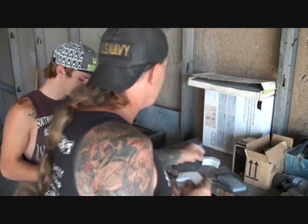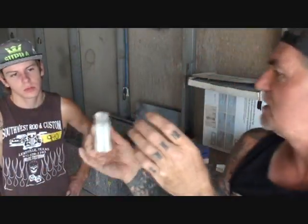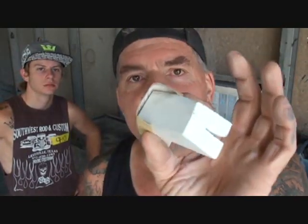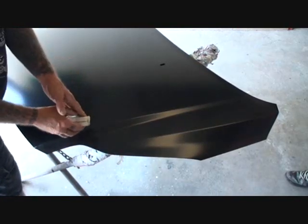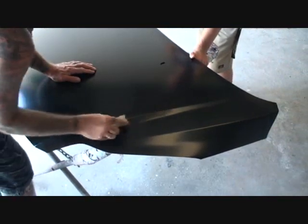What we're going to do today is take this condensed foam right here. These are pieces off the hood that was shipped to us — corner protectors — and these are very handy items to make blocks out of that will be precise and accurate to what you are trying to do. Take this block right here — we would probably just keep it just like it is because it has contours, sharp edges, and it's very small. You can take your stick-on paper, stick it on the block, and wrap it. Do you see how tight I wrapped that? Once it's wrapped, it becomes a little hand block you can use in very tight corner spots.